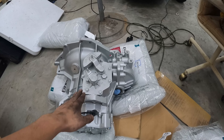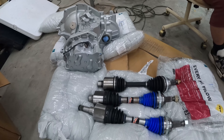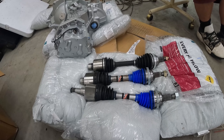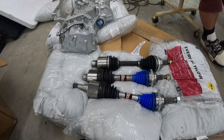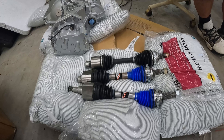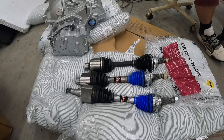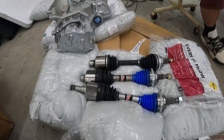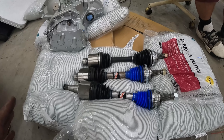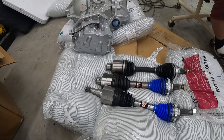There is also the intermediate shaft that comes out of the transmission. There aren't a lot of upgrade options for that, but I'm taking my factory one and I got one of his bearings that I'm going to press onto there, so I'll have a stronger, heavier-duty bearing that should handle the power. As far as the drivetrain is concerned, for the clutch I'm looking at still doing the six-puck. I may have to convert to a twin disc if I have problems in the future, but I'll be starting with the ACT six-puck clutch — it actually came on one of my cars.